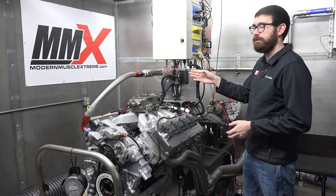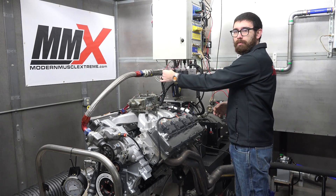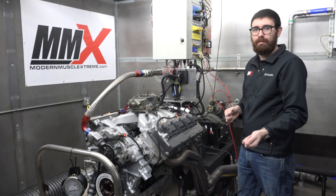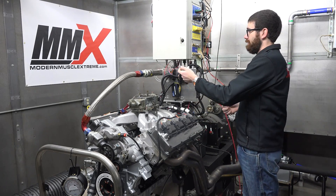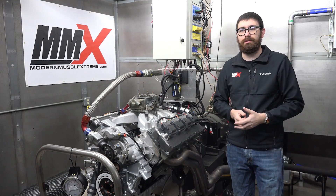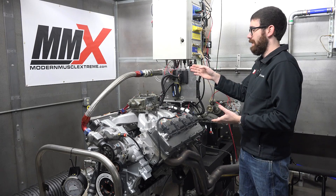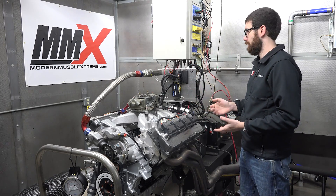The system is very capable though. It does have a few extra wires. It has a green wire here that is a tachometer output wire, so you can take that straight to your old school tachometer in your car. It has a pink wire here, and that is an input for a wideband oxygen sensor because the system is capable of data logging. So you can hook your wideband straight into that and log your air-fuel ratio, which is pretty cool.